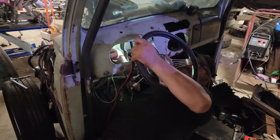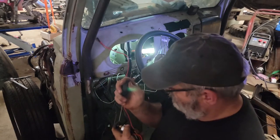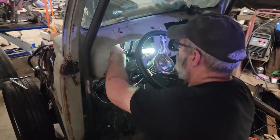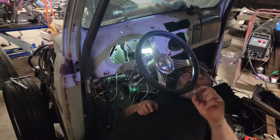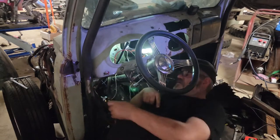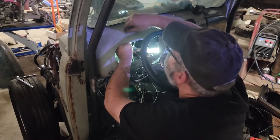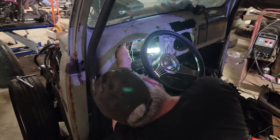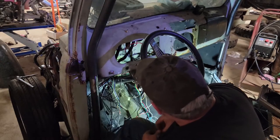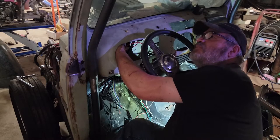Well, that ain't going anywhere. Now, all we need to do is mount the switch. So yeah, just a little straight lock screw here to lock the knob in. Nothing fancy there. I'm going to put that through and deal with this little excess of wire here. Now, that's interesting. There is the screw that holds the motor to the bracket. We're going to be putting that in the smart way instead of the way they had it. Okay, let's try to mount our switch. So you got to have the motor down to put the switch in. I wonder how intentionally universal they made this, because that switch is hitting the motor. Alright, that'll work. Now you can put the screw in the right way with the nut on the back the way it should have been in the first place.